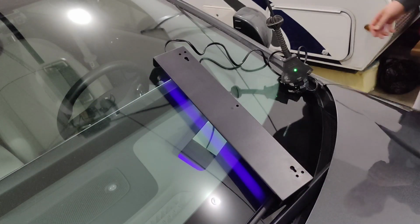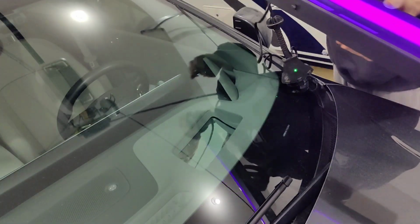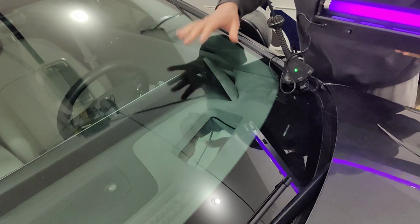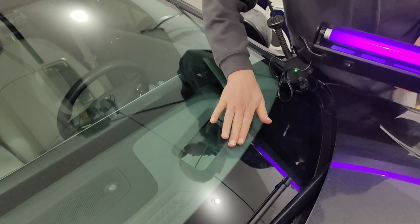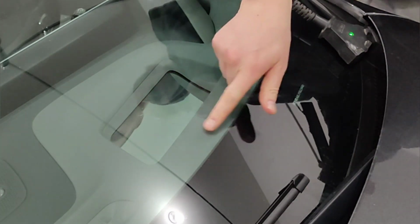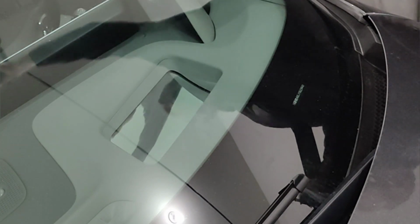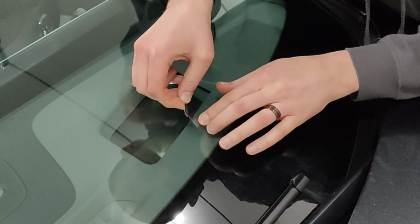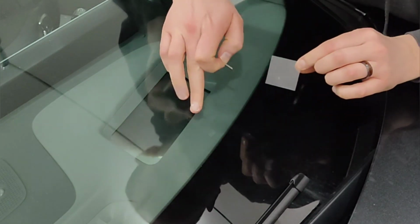Okay, so the UV light has been sitting over top of our repair now for well over an hour. I did use a little bit of the resin to kind of fill in a couple other little spots on the windshield, but they're not going to cure because you actually have to eliminate the oxygen from getting to your resin. Because if it's exposed to oxygen in the air, it just won't cure. At least it will take a long time anyway to cure. And that's why you have the little tab, the curing tab that goes over top of your work. So the next step is to peel this back and hope that our resin cured properly. And it did. Perfect. And we can use the razor blade to just get rid of the old resin.